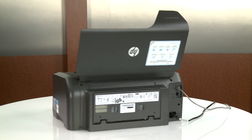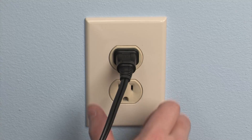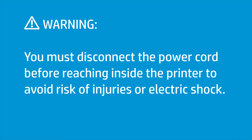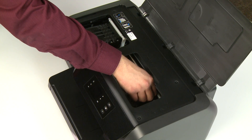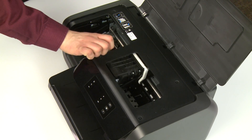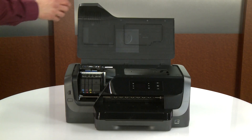Go to the rear. With the printer still powered on, disconnect the power cord and any other cables. Disconnect the other end of the power cord from the power source. You must disconnect the power cord before reaching inside the printer to avoid risk of injuries or electric shock. Return to the front. Use a flashlight to look for paper that might restrict the carriage. Remove any paper or objects you find. Reach inside the ink cartridge access door and manually move the carriage to one side and then to the other side. Remove any debris in the carriage path. Close the ink cartridge access door.